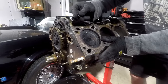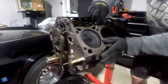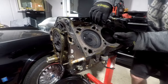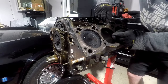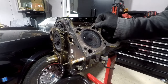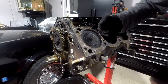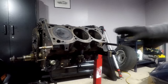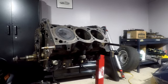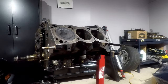I'm taking a fresh razor blade and scraping all the old gasket material off perpendicular to the surface. If debris lands in the block, we can vacuum it out — we don't want it in the coolant jackets. This looks like copper material so it's going to take a little while, but we have to make sure we get it really clean. The razor blade goes over the entire head gasket surface, the timing cover, and intake valleys. The block is now prepped and good to go for a classic piston install.